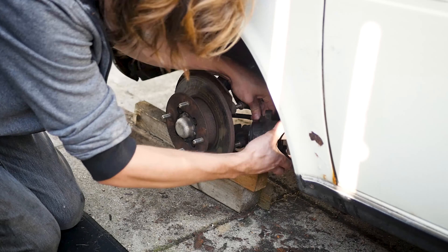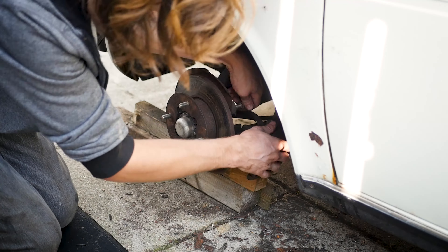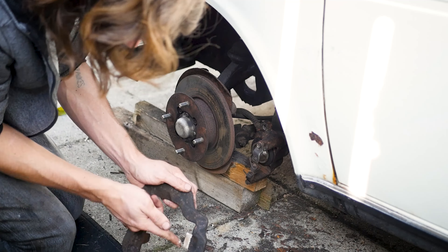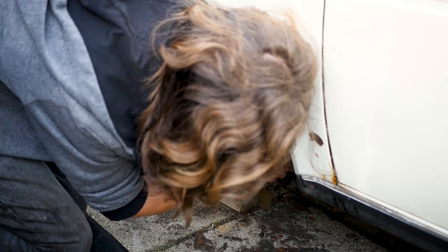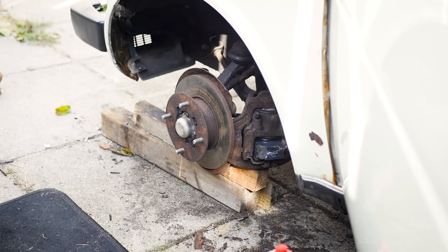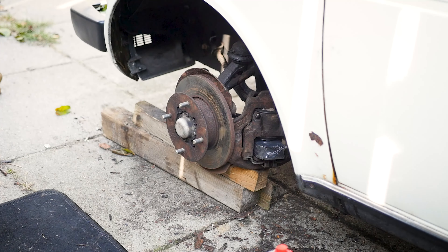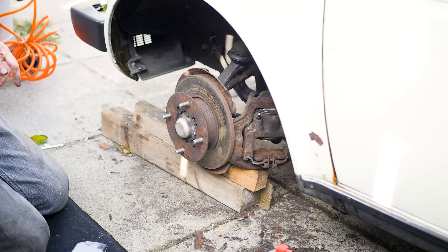The pistons are now very free to move, very easy to move. So I went to install them the following day. They moved so freely that one or the other side kept popping out. But with some compressed air I was able to fix the issue and continue installing the calipers. I also used copious amounts of grease on the guide pins to make sure that nothing locks up in the future, and I greased around the caliper and the brake pad contact area as well.